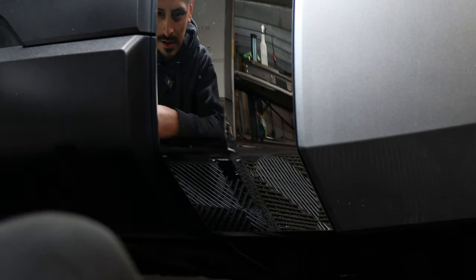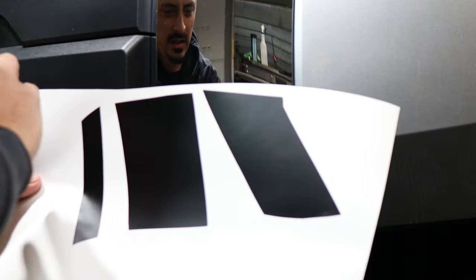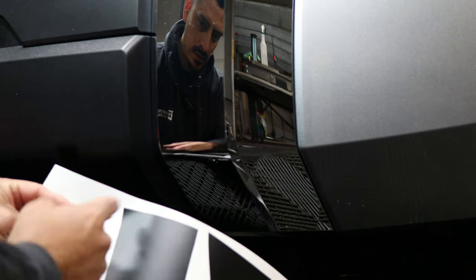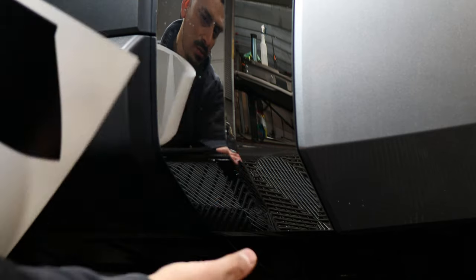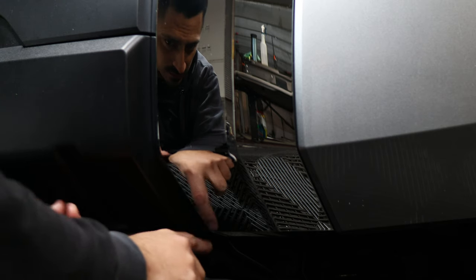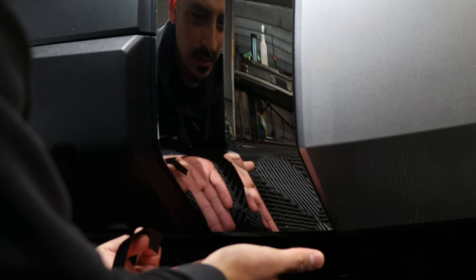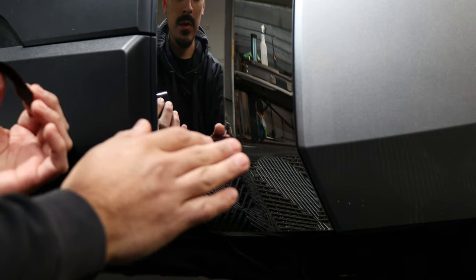To make things easier, I cut the long bottom piece in half so I'm able to just peel and stick. We're going to start with the edge first. This inner piece goes on the edge, the big middle piece covers the center, and the outer piece goes on the outer side. Just peel, align it to the bottom edge of the chrome, and tack it down. You will have overlap on each film, which is why we start from the bottom — the last piece overlaps on top.